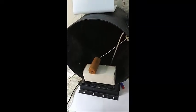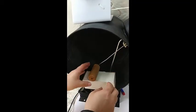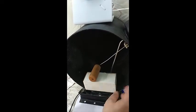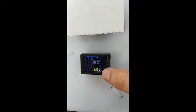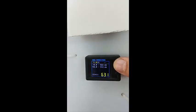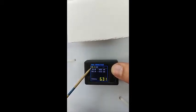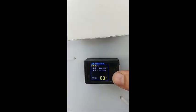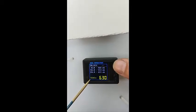Don't leave the gas station because we need to fill 10 more liters to calibrate our sensor. Before there was 10 liters inside the tank, and I added 10 more. Now my fuel tank has 20 liters. Run your car in LPG mode, enter the calibration screen, and you will see the sensor position has changed. To save this new sensor position, I will enter 10 liters — and totally 20 liters of gas. I am saving this value and exiting. It's saved.